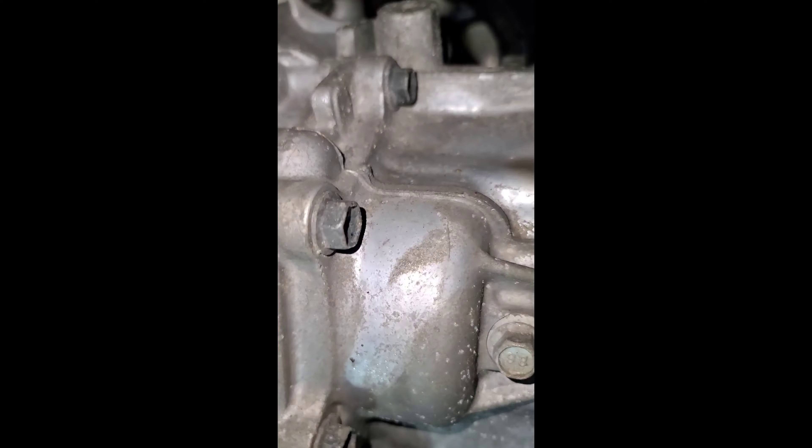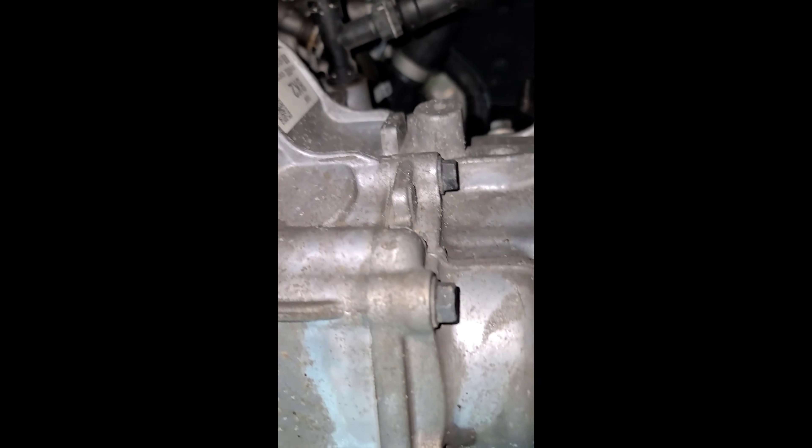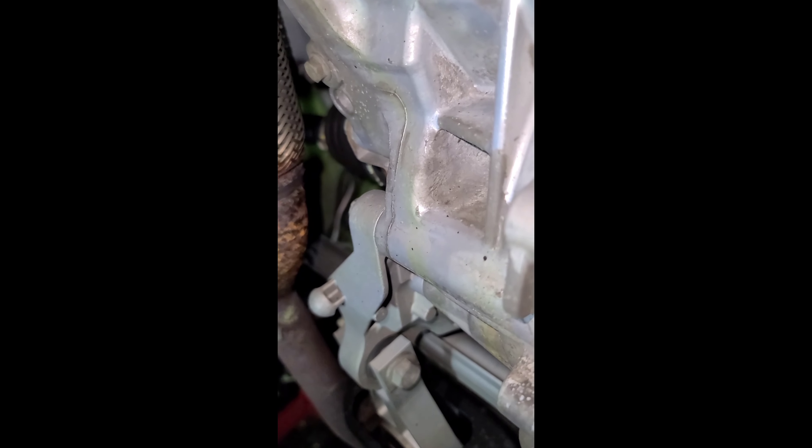Right there is your drain. You have a transmission mount back there, one axle comes in there, another axle right there. I'll have to find where the filler is — might be up here. I'm going to go ahead and get this drained. Looks like it just takes a 3/8 ratchet to pop that drain plug loose, and then I'm going to start pulling that and getting some of these bolts undone around the outside — they look like they're 15s, so pretty standard.